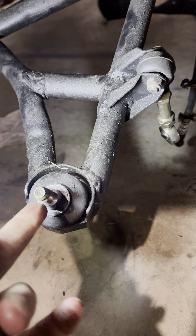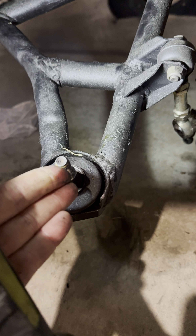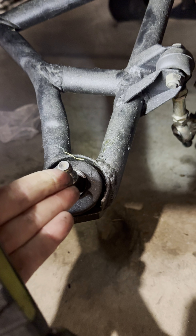I'm thinking about whether to change the lower ball joint now or save it for the new A-arm when I find one. I did order the bushings, so we're gonna put all new bushings in there. These aren't in terrible shape, they're just a little dry rotted. All this grease and mess is from the shock — the shocks are leaking. You can see a little bit of drip there. That's what happens with these supercars when they sit for a long time.